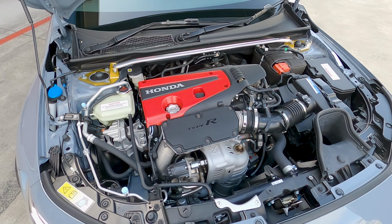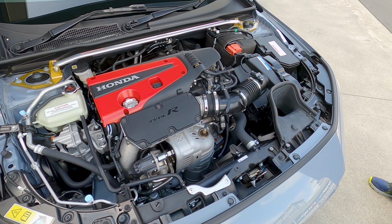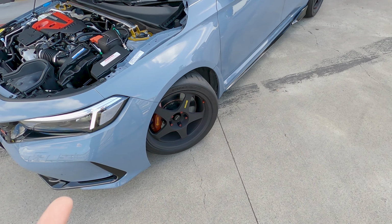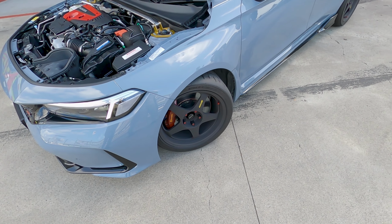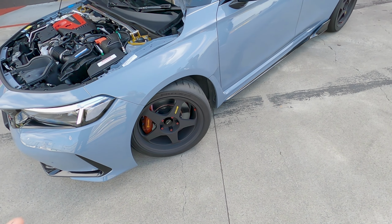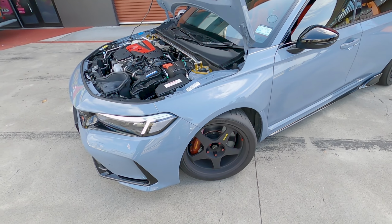So that was a really good drive with Tony's FL. The car is pretty much stock, just springs and brake pads and some tires. We didn't even put the camber kit in it, it had more camber. But it's quite interesting, it doesn't understeer like the FK. The back actually comes around at the sweeper. The R mode is stiff, but controllable.